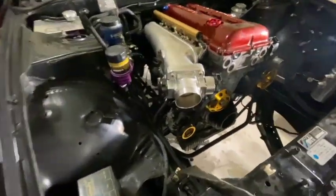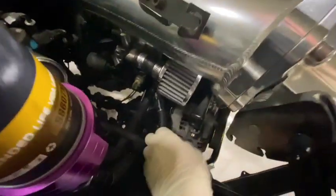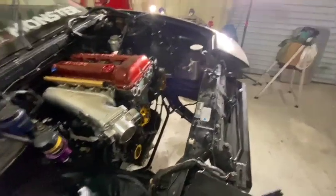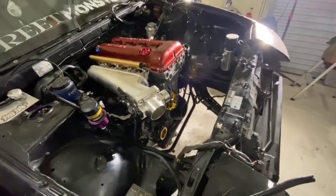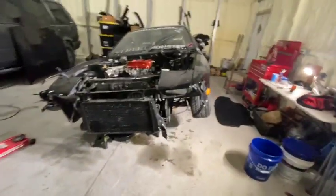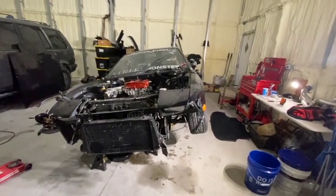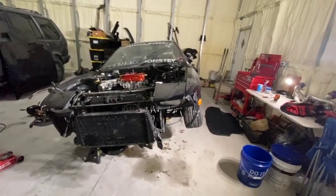The oil lines up here need to come off and I have to disconnect my alternator underneath all this stuff. I just gotta take off the two little ground and power connections on there. The radiator came out. Yeah, it sucks not having a lift but we're doing what we can without one - either way this project will get done. Next thing it'll be is it'll be out on the ground, so let's just keep chugging along and then we're gonna get this rear subframe out tonight.